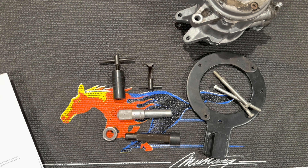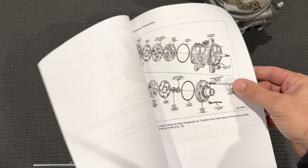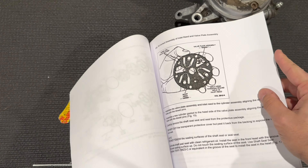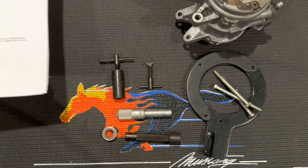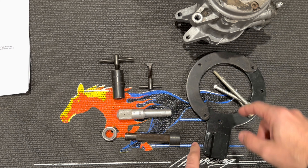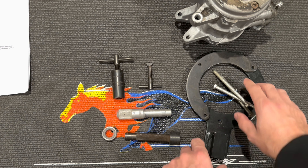Here's a look at some of the tools you may or may not need during assembly. I'm going to put a link in the description to a good PDF service document for this compressor that lists step-by-step disassembly, an exploded view, various parts, and tool part numbers. This tool here is used to hold the compressor — with three bolts you basically encircle it, clamp it in, and put it into a vise. I tried using it but found it was much easier to just do the compressor on a bench top, so you may not even want this tool.